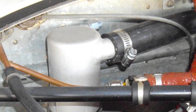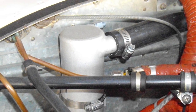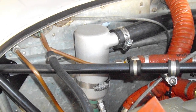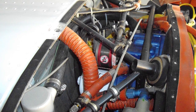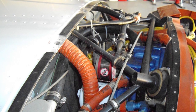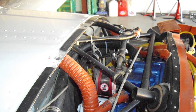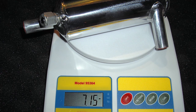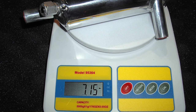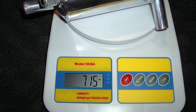The unit for the IO540 is slightly larger, including the tubing sizes, because the IO540 can potentially pump slightly more blow-by — by as much as 50%. It's still a very compact unit, only about a quarter of an inch larger in diameter than the one for the O360 or O320. These things weigh just over seven ounces with the plugs installed in the fitting on the bottom; without the plugs it comes right at seven ounces.